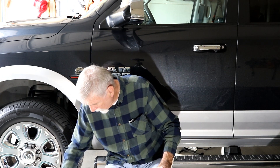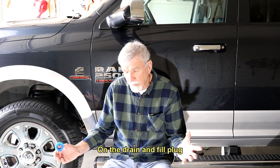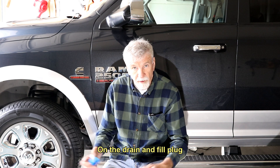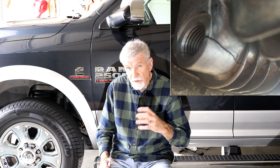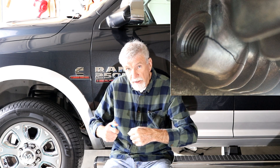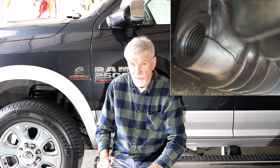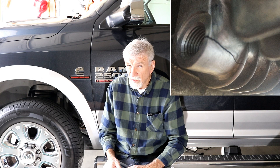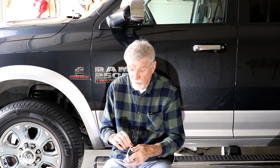Shop rags. Now, the pipe thread on this thing — you've got to be careful with pipe threads because it's a tapered thread. I call it a pipe thread; the official name is NPT, National Pipe Thread. You've got to be careful with that, as opposed to the drain plug on your differentials where it just screws right in and bumps up flat and then you torque it. A pipe thread is a tapered thread, so as it screws in it's expanding. Those are the threads that will crack an aluminum case faster than anything else. So we want to be careful. I don't use a torque wrench with pipe threads, and I also put a little Teflon on it, which will actually make it crack faster if you go too much.